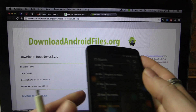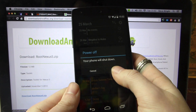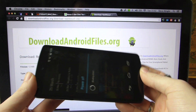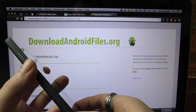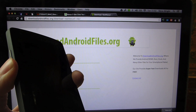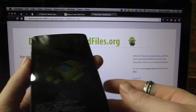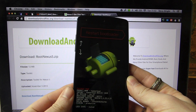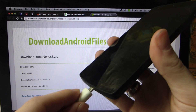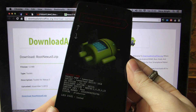While that's downloading, I'm going to get my phone and turn it off. Power off. And you want to boot your phone into bootloader mode. To do this, all you need to do is hold Power and Volume Down, and your phone will reboot and look a little bit like this. You then want to get your phone and plug it in, making sure the USB is the right way around. So that is now plugged in.